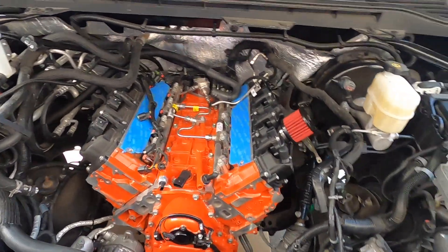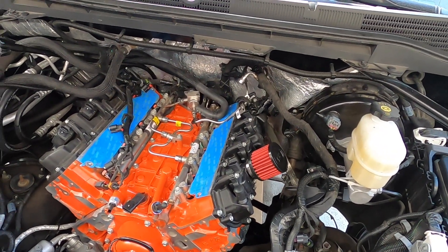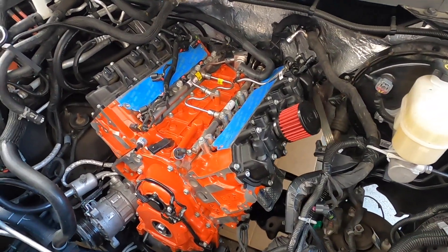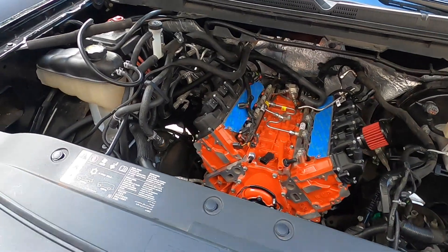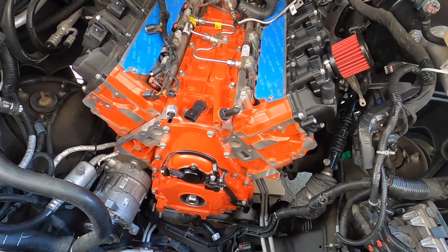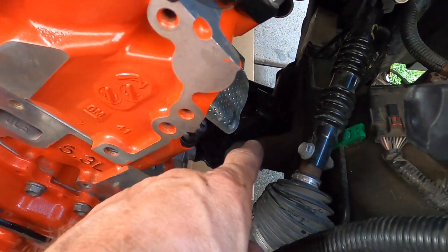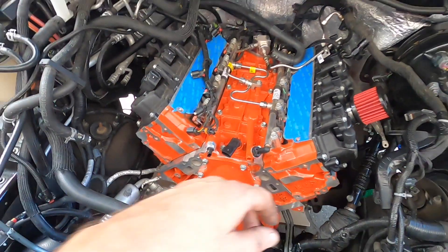Give me a few minutes and she's in — not too bad. Did have to loosen up the transmission. You saw how it was propped up on those pieces of wood — I basically got the dowels lined up with the transmission, knocked the wood out, and it just flopped right into place. Super easy, one of the easiest engine-to-bell-housing mates I've ever done. The motor mounts kind of automatically lock in place so you're not fighting to get a bolt in. Lots of room.